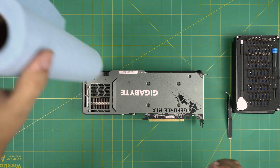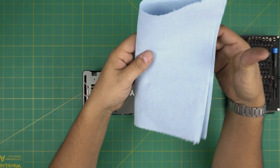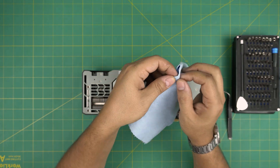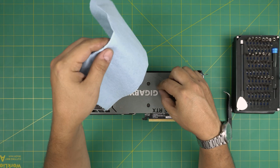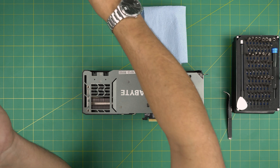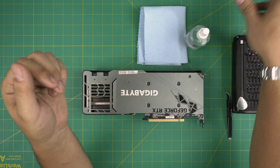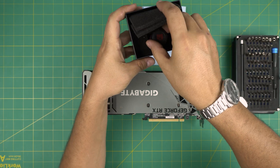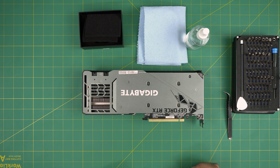For opening tools I usually use a guitar pick, but for this one we don't need opening tools like that. We're going to be using a workshop towel — workshop towels are really handy. Don't use any microfiber towels; use a workshop towel, because once you put alcohol on it and rub it over the capacitors, a microfiber can tangle between the capacitors and the strings will pull the capacitors and you can damage them. We're going to use 99% isopropyl alcohol and a good thermal paste — Thermal Grizzly. I'll leave the link in the video description.